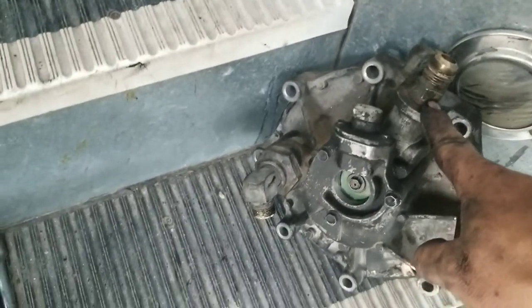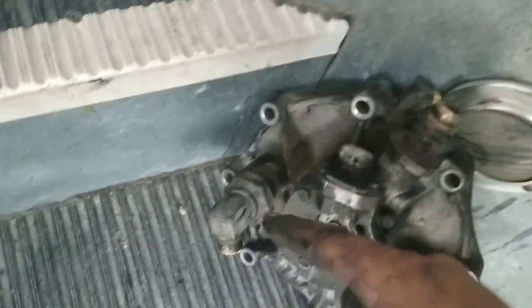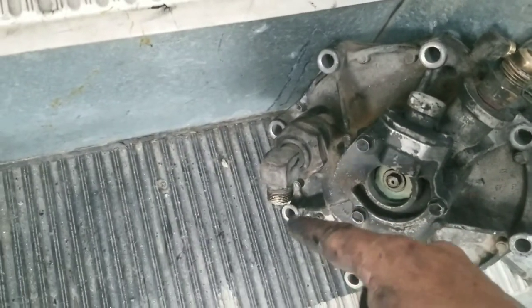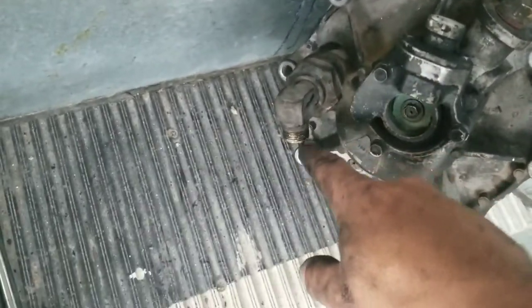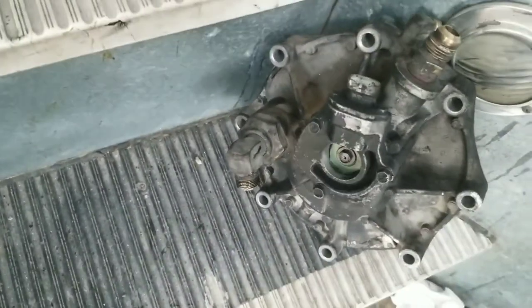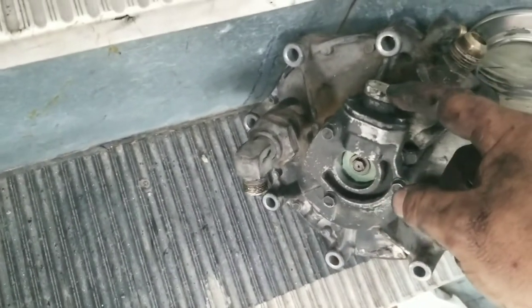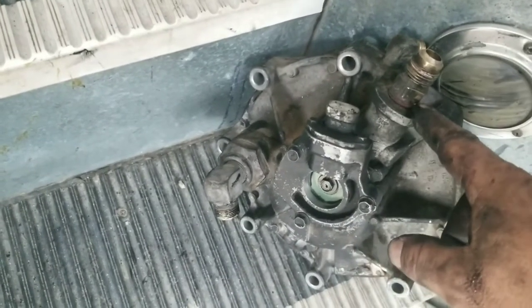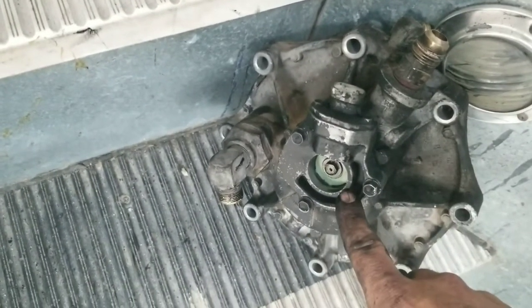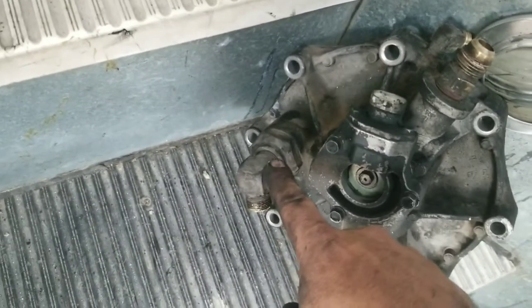That's just a fitting, and that's just a fitting. You're going to take these off from the bottom and unscrew everything to get the hoses off that relay back to everything - compressor to tank to regulator. And then this electronic piece, it pops right off. I've already cleaned this when I was over at another space, so I'm going to get to that next.